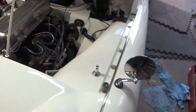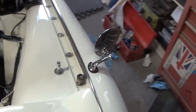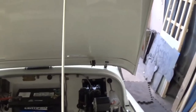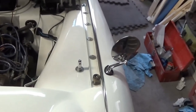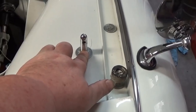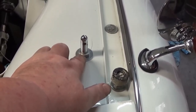In the meantime I was looking for a short power-hour kind of job. I was looking at these hood pins - it's on my to-do list to shorten them because they're not cinching the bonnet down as tight as they should, and that's creating a rattle in the bonnet at idle. What I've done is removed the hood pin from the passenger side and cut some more threads in the chrome bit to shorten it so I can pull it down further.